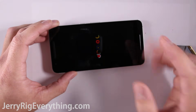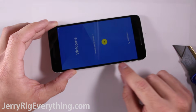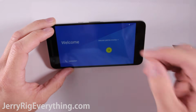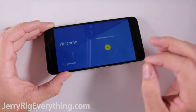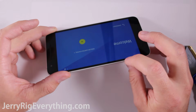The second design flaw, in combination with the first, is the thinness of the sidewalls on the 6P rear aluminum back. If the aluminum back and midframe were solidly screwed together, the thinness wouldn't be an issue, but since the midframe freely floats right out of the rear frame when it's bending, the sidewalls of the rear frame become super worthless all by their lonesome.